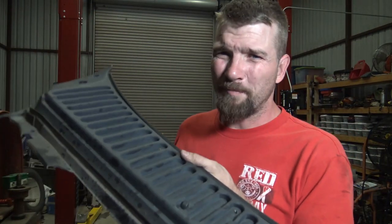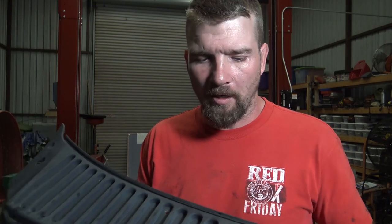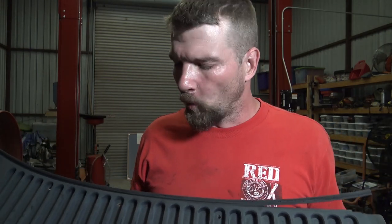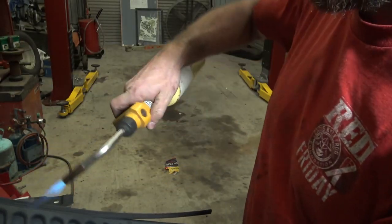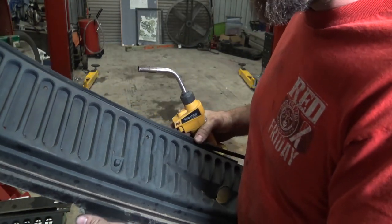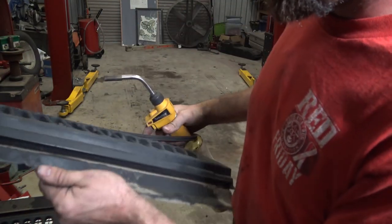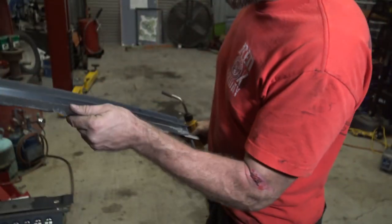Here's a tip about this cowl. Once these have been on your trucks for a while, they get a kind of dingy gray. You can paint them, but paint will end up flaking off eventually. There's products you can use like Mother's Back to Black — works okay. But the best thing I've found: just take a torch to it. If you do that with the whole thing, you can actually get it all the way back to looking pretty. Kind of cooks everything off and makes it shiny.